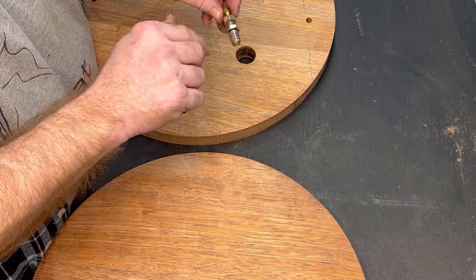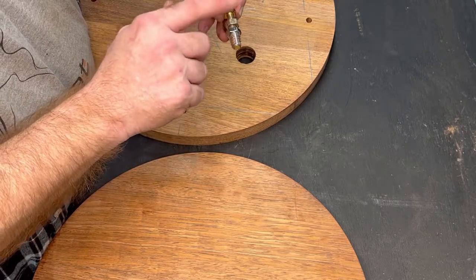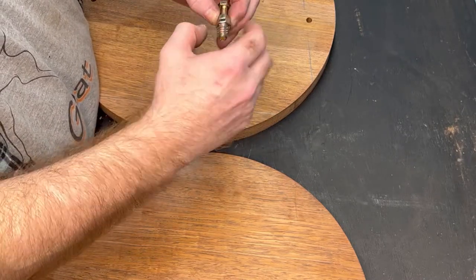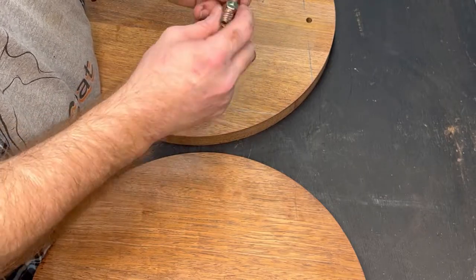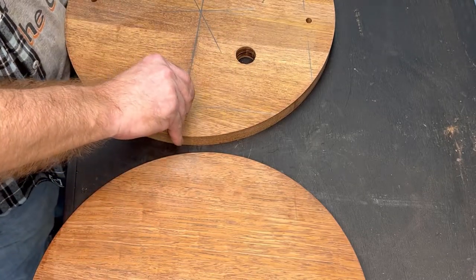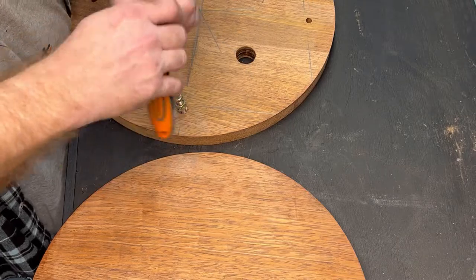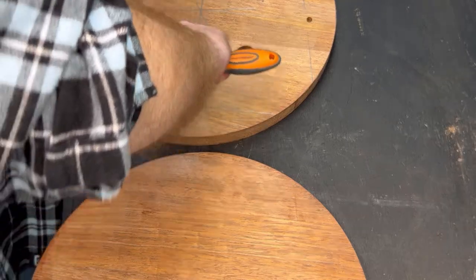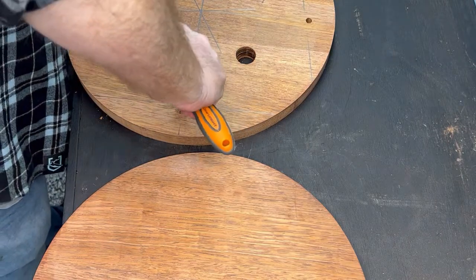Wind the first nut down so it's right up against it. Then wind the second nut down. Then turn them away from each other so they lock into each other, so they're not going to move. So now all we do is put it in place, get our ratchet shifter, and then all we're doing is winding it on.